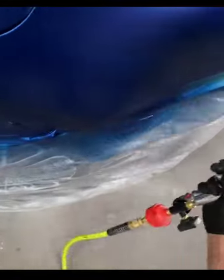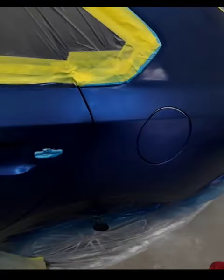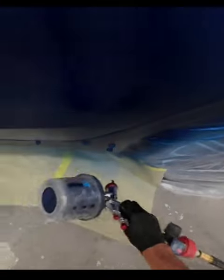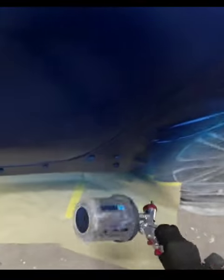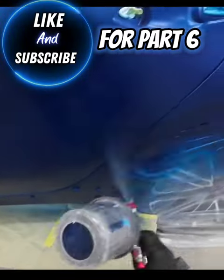This is going to give you a cleaner job when you apply your clear coat. We've already basically started our blend just by covering those primered areas, because some of that overspray is going to start your blend for you. But in order to get a perfect blend, we want to move back a couple inches from the panel and just put a light coat out into the rest of the panel.